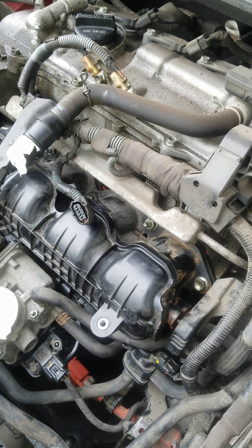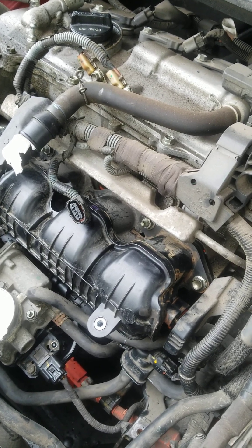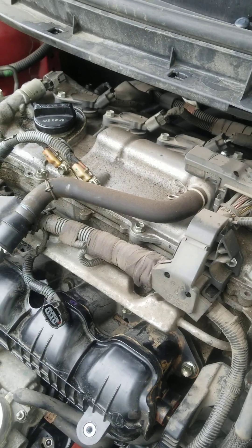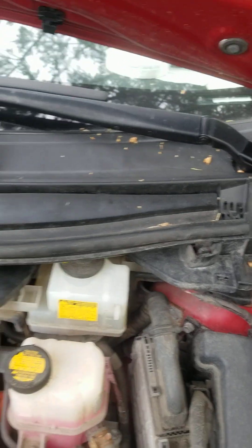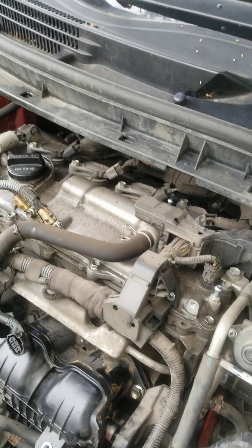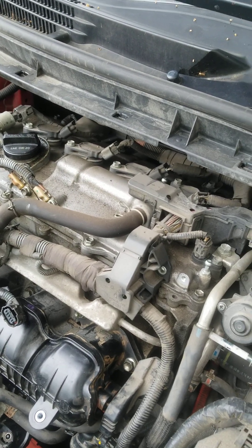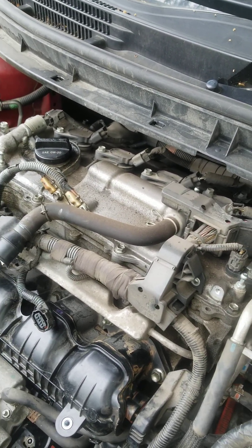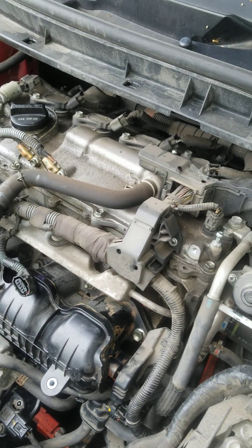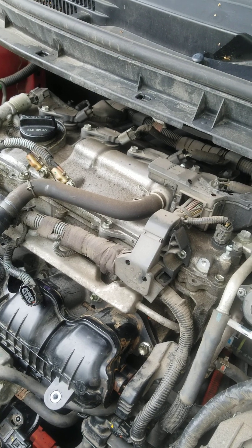I doubt the injectors. More likely, probably the smarter thing to do - and you can tell I'm trying to avoid taking off the windshield wiper cowling - would probably be best to inspect those spark plugs, as they might need to be brushed off or replaced. Those could have gotten a little sludge on them and struggled.